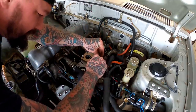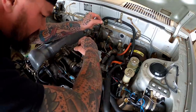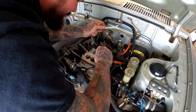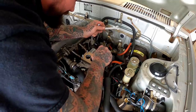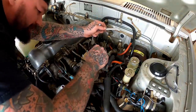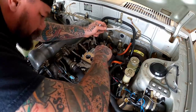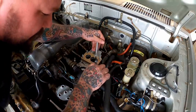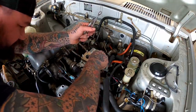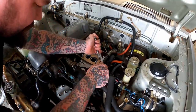Throw our extra studs in. A little Loctite on them babies too. Now this is where this one's gonna get a little tricky, because I don't believe it actually bottoms out in that adapter plate, does it? It's just gonna go through. Yeah. So if you torque on that too much, you're just gonna start putting stress on that plate. So I guess we get those snug a lug and then let the Loctite do their job. And hope to hell the Loctite holds it.